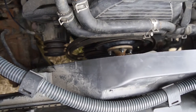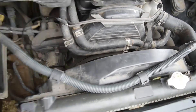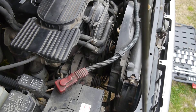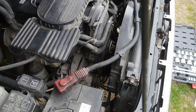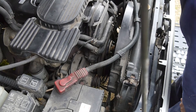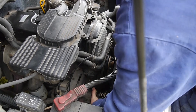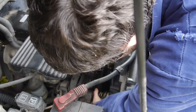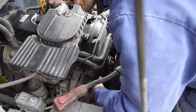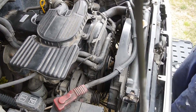I'm just going to run the engine and see if it's still making the noise. I've just got it sitting there, so I hope that's going to be okay and not get fouled up in anything. You can hear there, that's a way nicer noise. So I'm pretty sure the noise is coming from here — maybe the bearings in this guy. You can hear a bit of a clicking noise in there. So it is potentially the alternator.